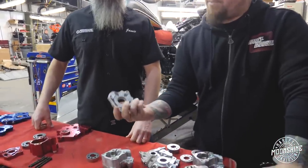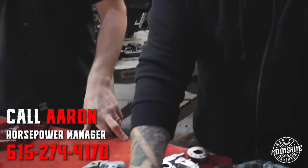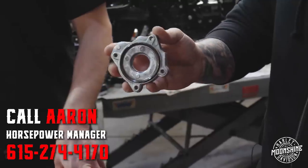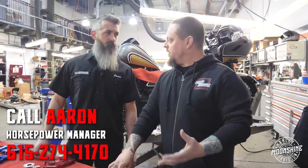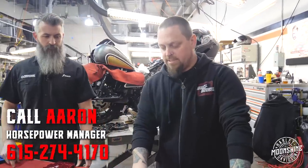This was the backing plate that was stock and fit all the oil pumps up until 2019. When through Harley's research and development, they found that if you put a seal against the crank case, it actually helped decrease the problem of cavitation. Air cavitation is the phenomenon they think causes something in the engines — when air gets inside the gerotor, it won't move the oil anymore. So this helped reduce that significantly.